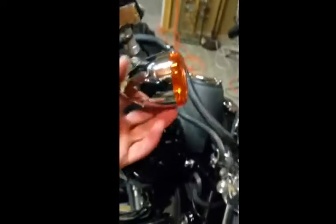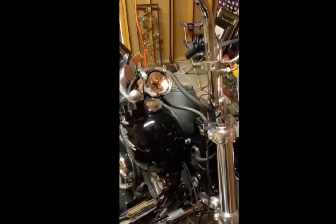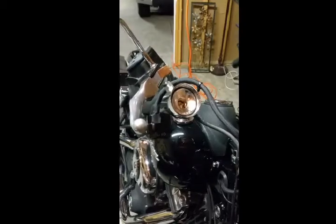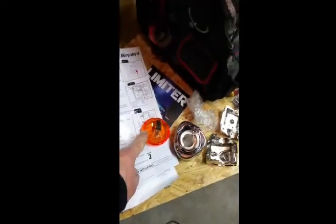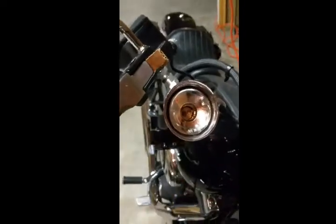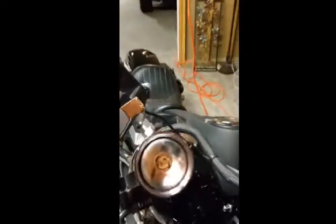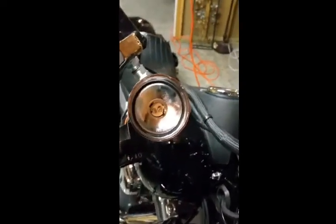It's kind of jammed in there because you've got this wire running out to your light, which you're going to have to disconnect. I've done this to the back — I'm going to get my screwdriver, pop this out, get that light out, and disconnect the wires. The orange cover pops off — it's got a slot for the screwdriver. Depress and turn left to get the bulb out. There's a little seal there you have to pop out — be careful not to ruin it.